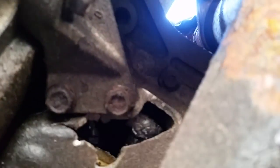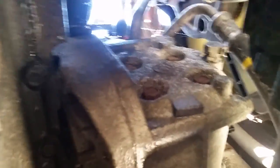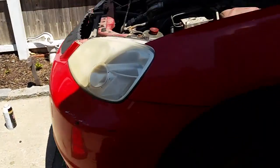We're going to change the engine anyway. I'll try to turn it over — it's probably something with a rod. I lowered it back down and raised the rear up so all the coolant could flow to the front of the car — I want to get as much of it out as I can so I don't have to spill anything when the engine's coming out. I sprayed the O2 sensor, all the ball joints — basically everything I could spray, since this car has been sitting for a long time.